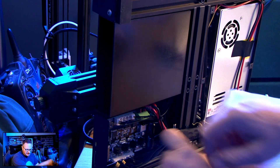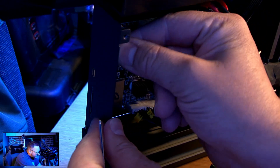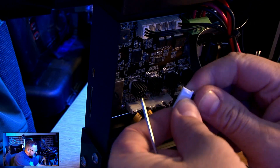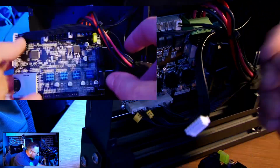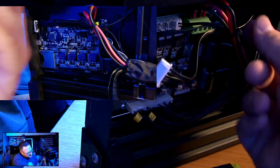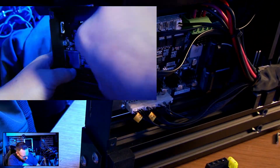It is like-for-like, so you're going to be unplugging one and plugging it into the other. Some of the parts are already labelled, which makes it really easy. There are four screws — bottom left, bottom right, top left, top right. I'm just unplugging the TFT screen at the moment and removing a bit of the glue as well, because it might not slot in as nicely with that blob on there. Since it is a like-for-like board, I'm just going to put a little montage here of things being removed and put in again.